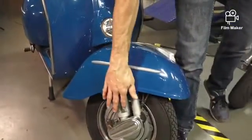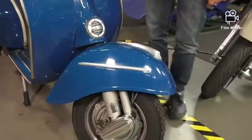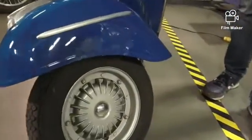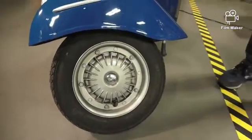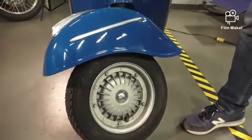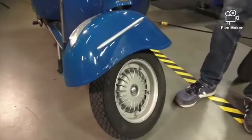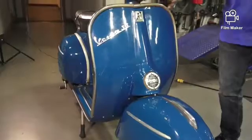The shock's a little bit rubbed out on it, but they also have a unique wheel arrangement where the wheel halves are a different width. They look much deeper, same with the hub design. Pretty much nearly every part of this front end is different than the prior model or the Rally 180, Rally 200, or the P200. It's actually closer to a P200 design front end.